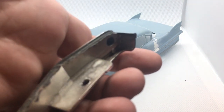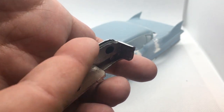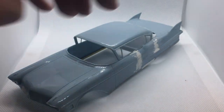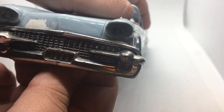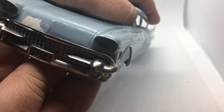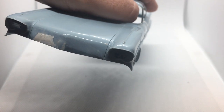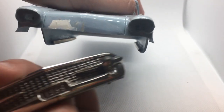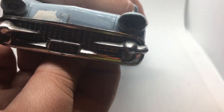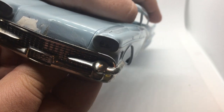The other thing I did was here on the back side of the grill, I cut a little notch just on the back side of that top edge. When I put it on the front of the car, it actually cleans up any little imperfections with that seam. And also because this plastic has shrunk just enough, these curves at the corners are never going to line up correctly, so this just goes over top of them and masks any problems there.